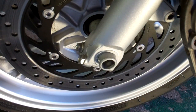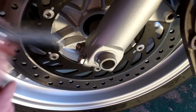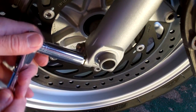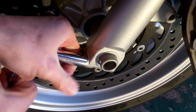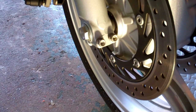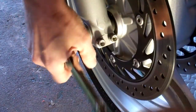The next thing you're going to do after you've taken the brake caliper off both sides — I'm going to skip the other side because it's the same exact routine. The other side actually comes off a little bit easier because you don't have the double hoses or the transverse hose on it. Your pinch bolts are right here, same exact size — I believe it's a 12mm. We're going to loosen up those guys a little bit. The nut on the opposite side is a 22mm. Put your socket on that and break that guy loose.